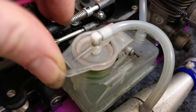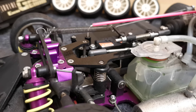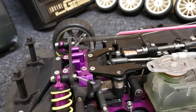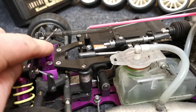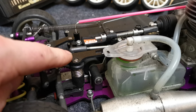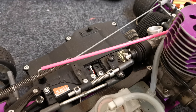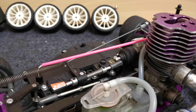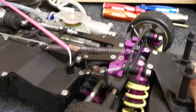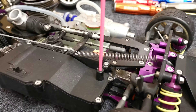You can tell this one has been stored for quite a while - it's got a load of green gunk in there, and you can smell it actually. It's got that typical old nitro fuel smell; just the oil is left and all the natural methanol's burned off. We've got some alloy hop-ups that have been put on here, and the carbon composite top deck is standard. It's running AceRC/Thunder Tiger Futaba original servos for the throttle and brake.